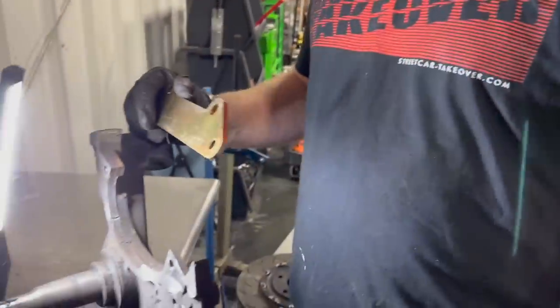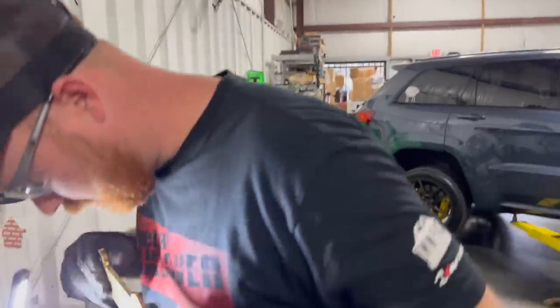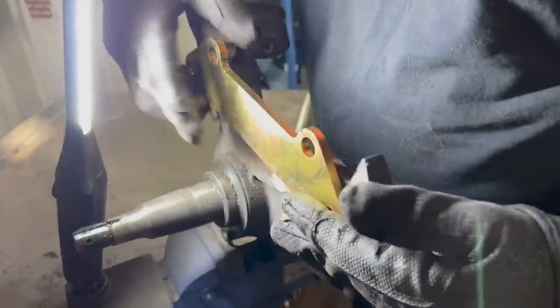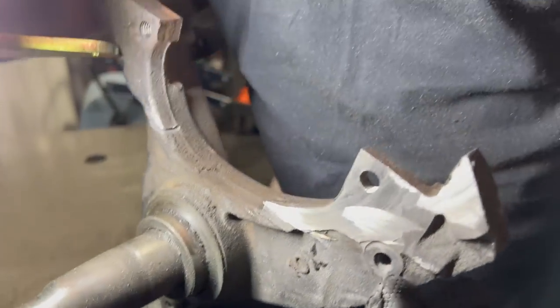What's the best method that you're using, Steve? They used to use a bandsaw, which would probably be the best and cleanest. We don't have a bandsaw, so cutoff wheel and sawzall method is what we're doing. Yeah, it's working. But yeah, so this rib here, it mounts on the front. It uses the existing dust shield holes, which we will have to drill and retap to a 7/16 bolt.